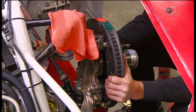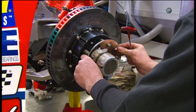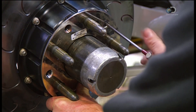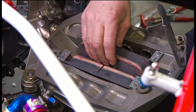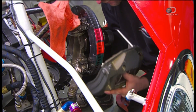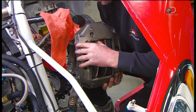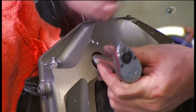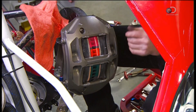Next, they install a brake rotor, then a steel spacing plate between the rotor and the wheel. This sets up the specific distance from wheel to wheel that NASCAR rules require. They load a pair of brake pads into a brake caliper and slide the caliper onto the rotor. The caliper contains different sized pistons, so that it applies the brake pads to the rotor evenly.